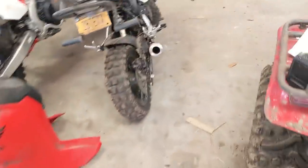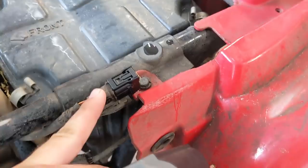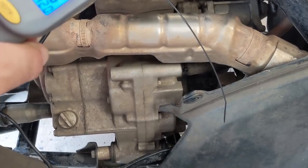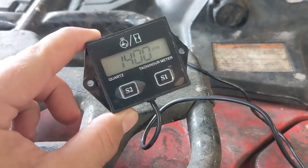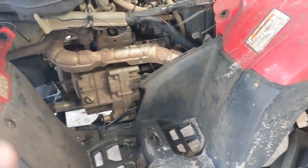I'm going to shut it off for a second and quickly plug in the O2 delete. Quickly is important because I want the engine to be at the same temperature when I test it both ways. There's the O2 delete plugged in and snapped in place — that's the factory one dangling. Engine temperature is 241, 242 — pretty close. And we're idling at 1,400 RPMs. So once the engine's hot, that's not doing anything. It's been idling for quite a while now and we're still at 1,400, 1,390, 1,400 — same exact RPM with the O2 delete. Driving around normally, this is not going to do anything to increase your RPM.